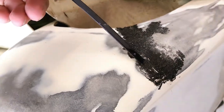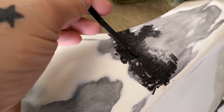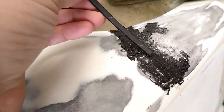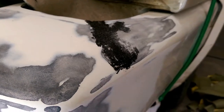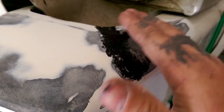What you want to do is go ahead and weld it like we did in the video, and then take a zip tie and melt it into your crack and just keep building it up, slowly but surely. Don't let it get too hot. Let it cool down after you fill some more, so you can build it up even.